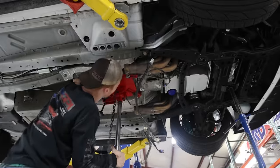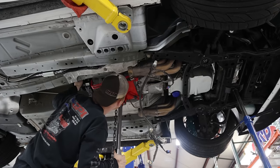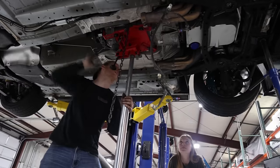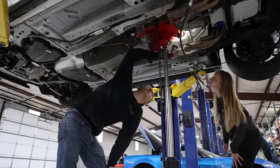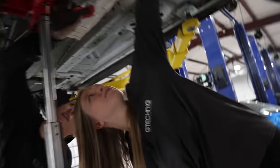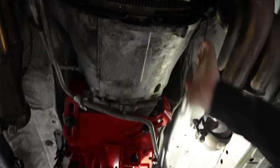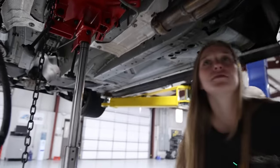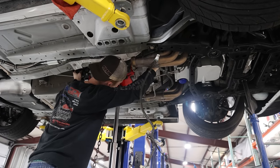Came out a lot faster than I was anticipating. You see the ear of the transmission up there? Where that ball hole is. All the way on the heat shield? Yeah, that's touching the heat shield. And that one does the same thing on that side? No, you gotta half-ass rotate the transmission instead, just so one side will clear and the other one will clear. She's out.